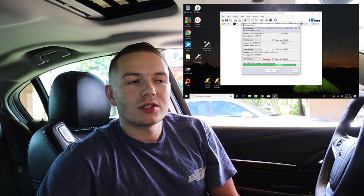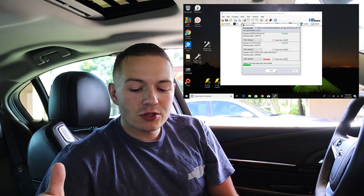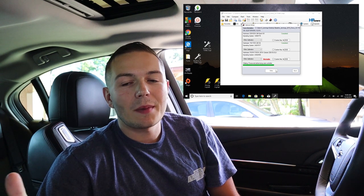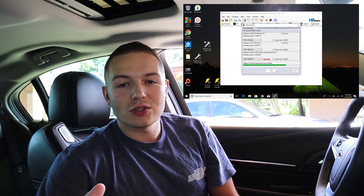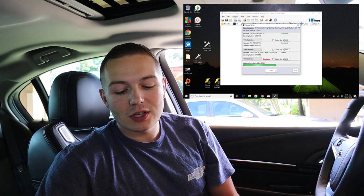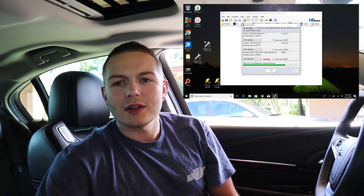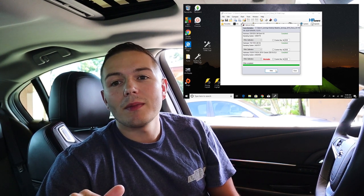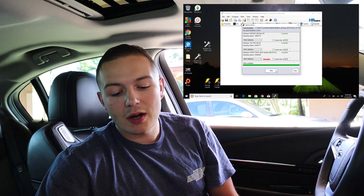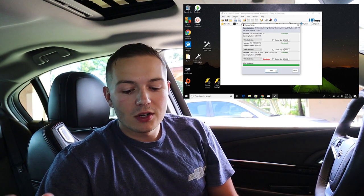The tune write just moved into the fuel system — and I'm pretty sure it's going to remain blank throughout since I wasted the extra 50 bucks on that credit. For future reference, when you buy credits from HP Tuners, you don't usually need to buy the FSCM — the Fuel System Control Module. Most of the time your tuner is only modifying the ECM and the TCM, so talk with your tuner before you pay credits for the FSCM — it'll save you 50 bucks.